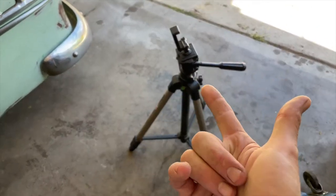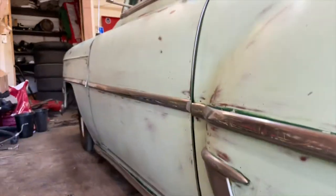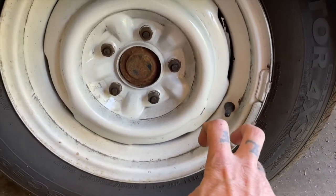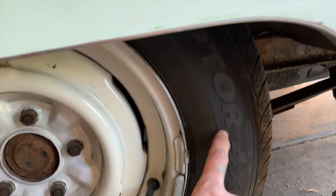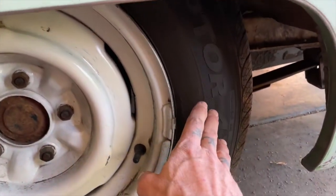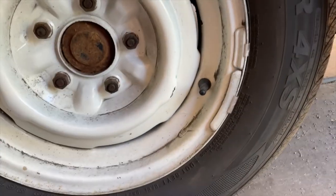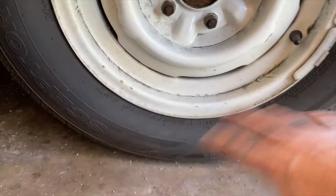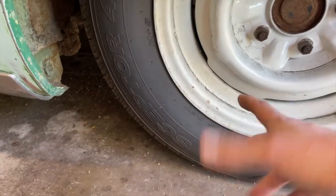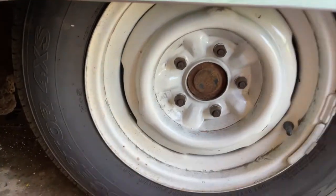It's going to be a good video - I got the tripod out. Today Jolene is going to be getting new shoes the rat rod way. The method is to take a 36 to 40 grit sanding flapper disc, grind all the stuff relatively smooth. You don't want to actually get into the smooth tire area, you just want to take off all this stuff. I usually just paint right over it but it looks kind of obvious, so we're going to jack this thing up and make it so we can spin the wheel freely.